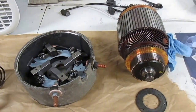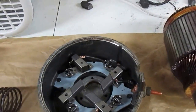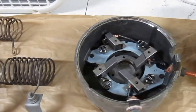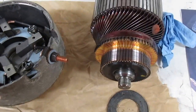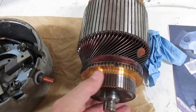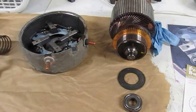Anyway, this is everything I've gotten so far. I'll probably make a third part of this video showing it all put together and running again. I'm pretty pleased with how it's turning out. The new brushes fit real nice, the new resistor fits nice, and the armature looks like it's in good shape. I am going to take some 400 grit sandpaper and just work on the commutator a little bit, but it's not really in bad shape at all. So I think we'll be back to new here shortly — thanks for watching.